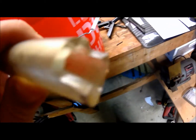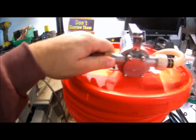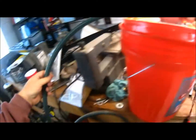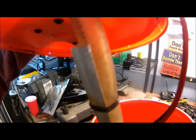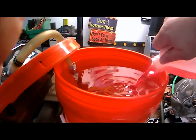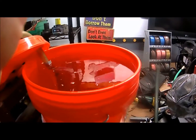Cut the line and make a little angle so it's not straight across and doesn't get suctioned to the bottom. Then I screw on a short hose on the outlet side of the pump — that'll tie into your jet ski or boat. I put a metal stiffener on that line just to keep it straight, as it was starting to curl up in the bucket.